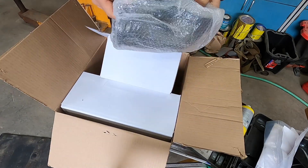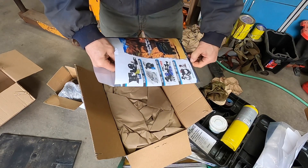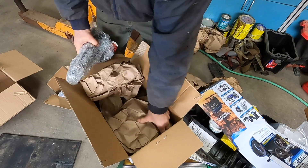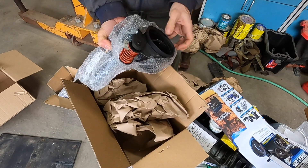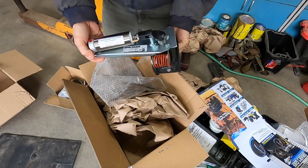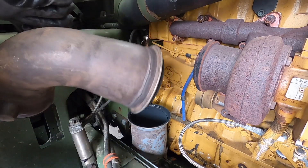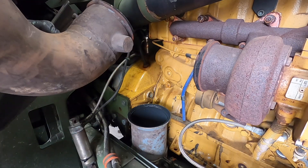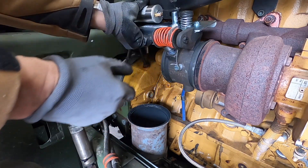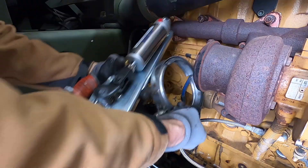There — that is the adapter. Let's see how that's going to fit on the truck. So I pulled the old one off and we have a four inch pipe here to five inch. This adapter was welded on to this pack brake but they don't do that anymore. So I have the four inch pack brake and they like this to be on top. The other one was here but they want it up, so I'm going to put it right about like that and put a clamp on that.